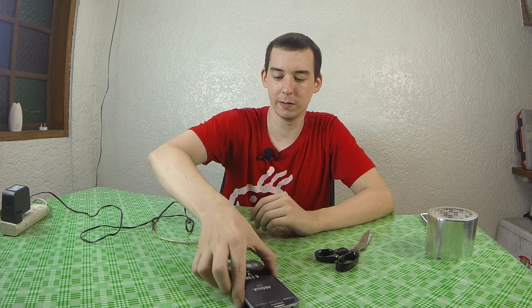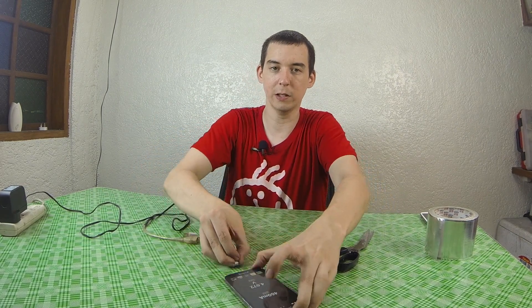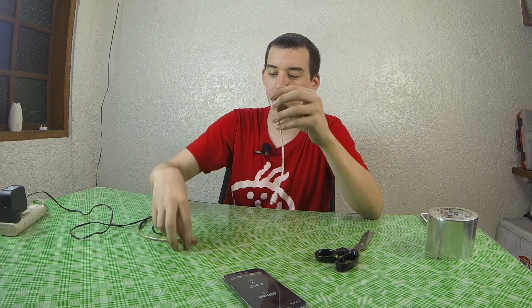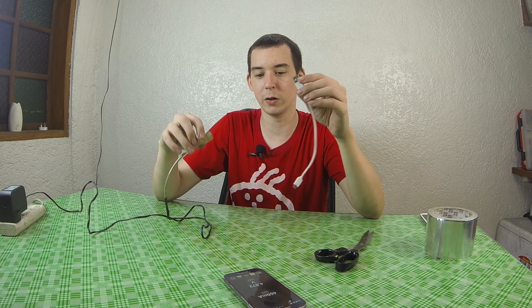This is very easy to fix. If you look at the USB cable — a regular micro USB cable — you'll see that there are four pins: the outside two for power and the inside two for data. If you short out the middle two data pins together, when you plug it in, the phone will basically know that it's connected to a higher current or AC charger and will then try to draw more power.